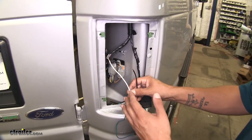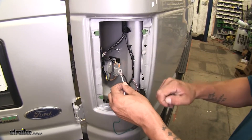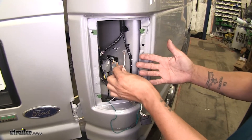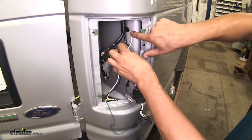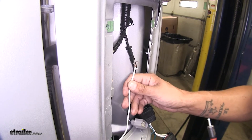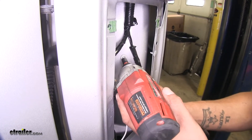Back on the outside on our passenger side of the vehicle, we should still have a black wire with the bare end and a white wire with a ring terminal. Our white wire is going to act as our ground, so we're going to need to secure this to a good grounding point. I'm going to take the provided self-tapping screw that's in our kit and secure it right to the sheet metal here. You always want to double-check what's behind what you're screwing into because you don't want to damage any wires or pierce anything else. I'm going to be using a quarter-inch nut driver to secure it into the sheet metal.